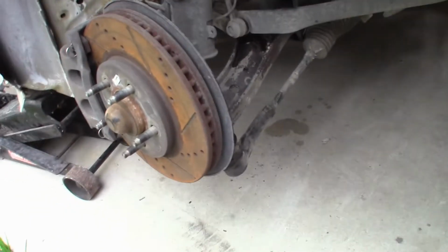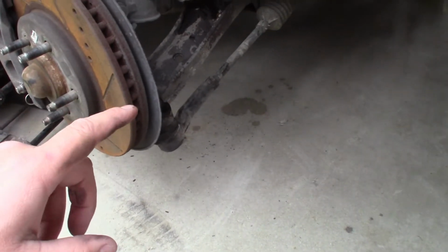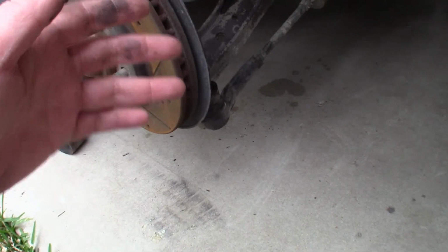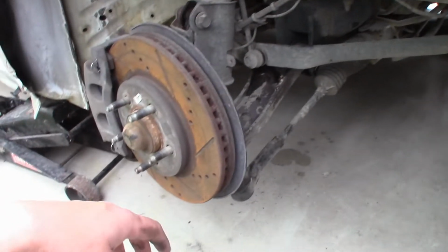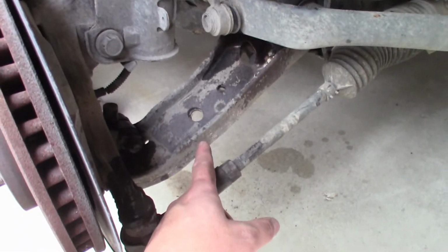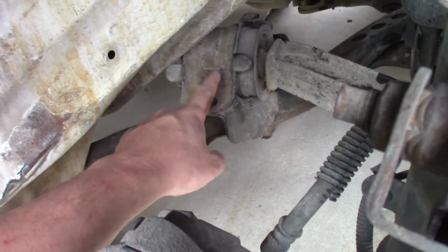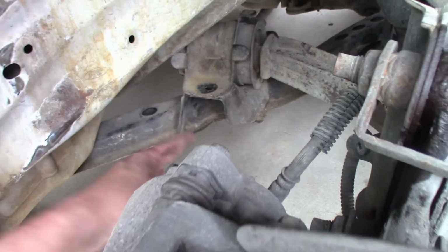Alright, I wanted to pause here for a second. I told you that I wasn't going to talk too much in this video, but I wanted to show you what I meant about having to replace every suspension component in this area. Let me show you what happened in here and what's typical. Usually it's the lower control arm that will crush first, and it's absorbed by the big bushing here in the back. Usually it absorbs all the energy, which is good because that protects the subframe.